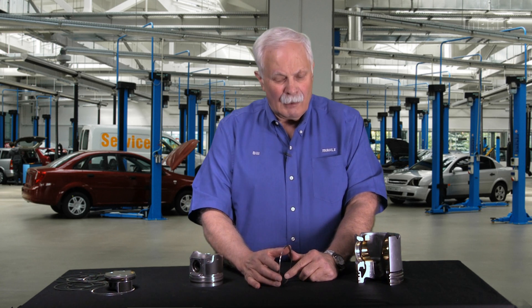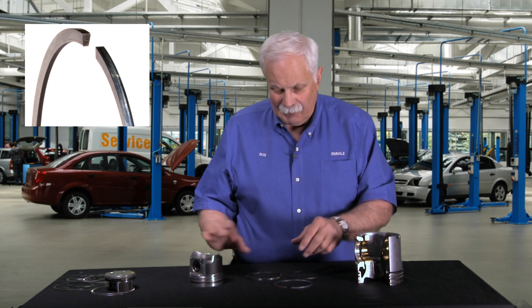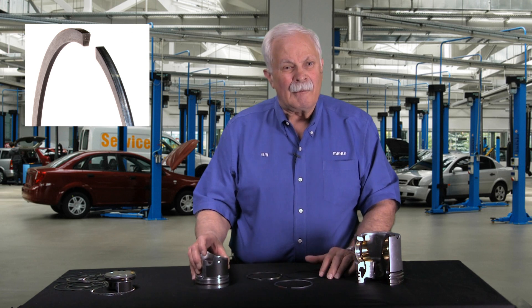The other big difference in diesel engines is that many of them — even the pickup truck diesels, and of course all the bigger ones — use a top compression ring that's what we call a keystone design. You can see in the close-up that the keystone design gets its name from the fact that from the face of the ring to the back side, both sides taper in and the ring gets smaller — it actually looks like a keystone, like Pennsylvania's road signs. The reason for the keystone design on the top compression ring of a diesel is it does a better job breaking up carbon that forms in the ring lands. Diesel is a fairly dirty fuel compared to gasoline, carbon tends to build up, long life is involved, and if the ring should stick into the groove and stop moving, we have immediate failure. So the keystone shape causes the ring to continue to break the carbon up as it expands and contracts, making the piston and ring lineup last a lot longer.